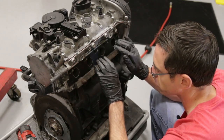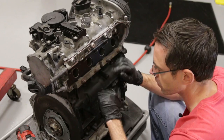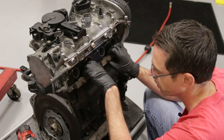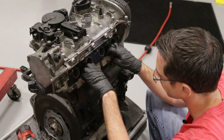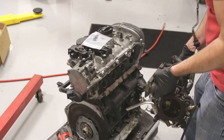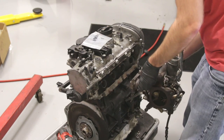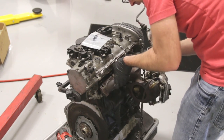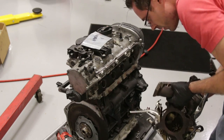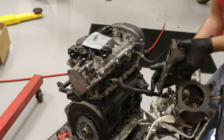Our gasket's good to go. We can now drop our turbo on top. This plate on the bottom is one you don't always need to remove when putting the turbo on or off — you may want to loosen it a little bit depending on fitment, but essentially it just has hooks that hang on, then you get the top portion rotated in place and get the nuts on. We're going to drop the turbo in place, but that bracket is still mounted which may give us trouble. Yeah, I'm definitely taking off that bracket — that bracket's not going to work. Actually we were able to just rotate it out of the way.